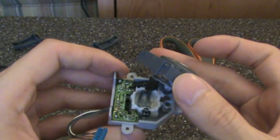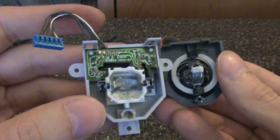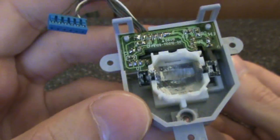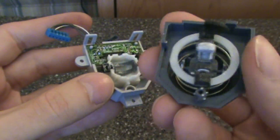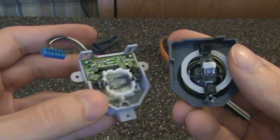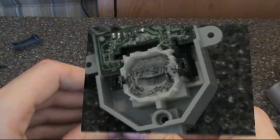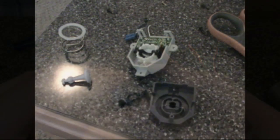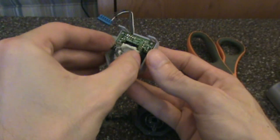Here's where all the magic happens. It looks like someone left a stash of cocaine in my N64 controller — no wonder it doesn't work so well anymore. This is actually dust from the control stick; as it wears itself down, it becomes loose, and I just never expected to find nearly this much of it. The first controller I worked on was my extreme green controller, and just look at all the dust that was in it. So all this needs to be dismantled and cleaned. The analog assembly contains the stick itself, the spring, a vertical motion bar, a horizontal motion bar, and the actual circuitry. Take it all apart and clean it up nice.